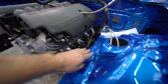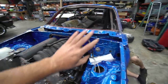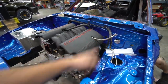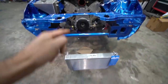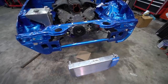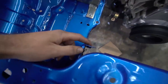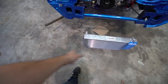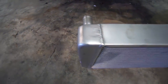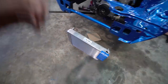We test fitted the header again to figure out all our clearances. He needed to figure out line routing — he's running returnless, so the filter regulator will be mounted back there. He's also got to run an oil line from his AccuSump mounted in the trunk. The next thing we need to do is get the radiator mounted. It's just a universal radiator. We've got to cut the cap and block that off, then make some mounts. There are two tabs on the car with threaded holes at the top, and we'll build something off the car and radiator at the bottom. My concern is this radiator has a coating on it, so I'll need to grind through and get it really clean before welding.